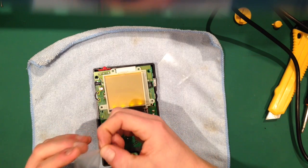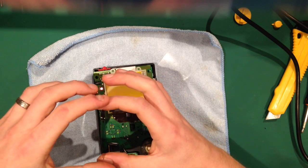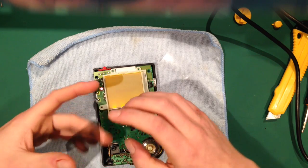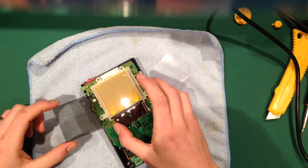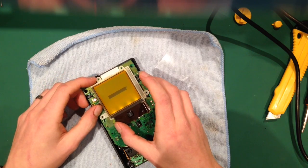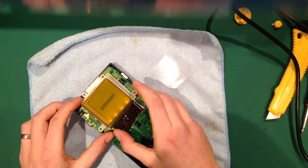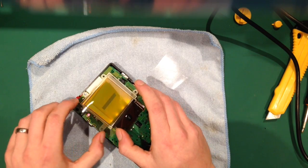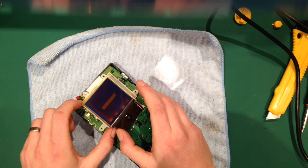And as I said earlier, see the bend to it. That's not me squeezing it. That's the bend. Try to put the bottom of the bend touching the LCD panel. So if you put it in this way, you get a standard screen. Or if you put, so that's with the little sticky out bit at the side, sorry. If you turn it and put the little sticky out bit at the bottom, you get an inverted display.